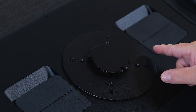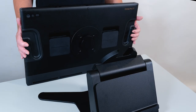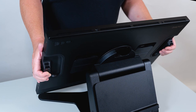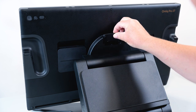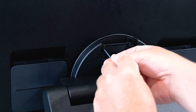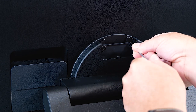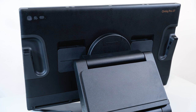Make sure that you have fixed the pivot plate in the right orientation, as indicated in the quick start guide. After we have successfully installed the pivot plate to the Cintiq Pro 27 display, we will move it carefully over the stand and insert it into the arm. The last and final step of the stand assembly is mounting the VESA plate stopper — this is fixed with two screws that are already pre-attached to the plate. Just gently screw it to the pivot plate. Finally, you will have the plate cover, which can be fixed, and we are done.